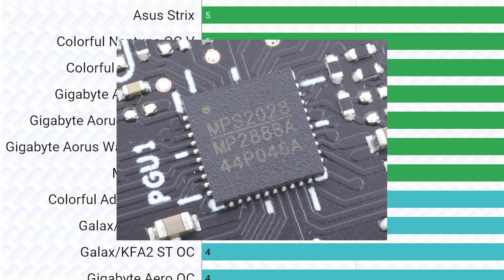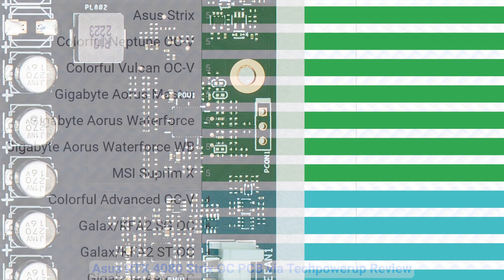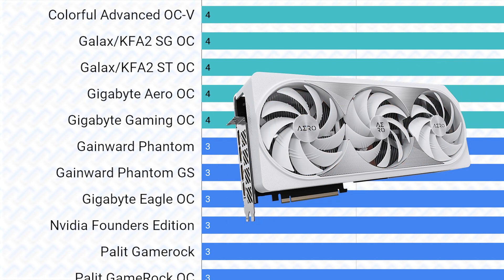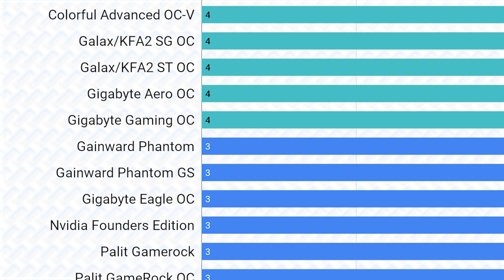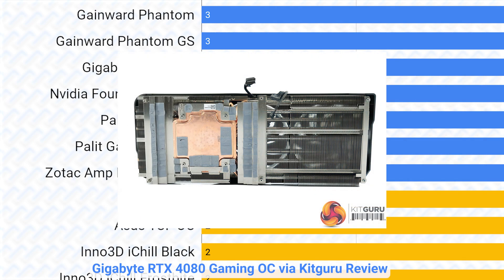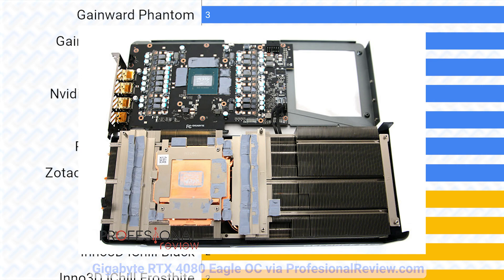Although this time the only card really suitable for extreme overclocking is the ASUS Strix, which still has a digital voltage controller with an I2C interface that you can solder to an external controller. The next tier down is the S tier, which does everything right and should be as good as it gets for anyone just looking to use the RTX 4080 or even overclock. The VRMs on all the 4080s are so overkill, and these cards all still have vapor chamber coolers with essentially the same power limits as the SS tier cards — so they're basically just as good, maybe just lacking a few extra features and better build quality of the SS tier. In fact, even the A tier cards are still really impressive. The Gigabyte Eagle OC, for example, has the same vapor chamber cooler and power limits as the Gigabyte cards in the S tier, except it has a slightly worse VRM, so it should only be an A tier card. But again, VRMs don't really matter, and this card should be the strongest contender for best value if you can find it cheaper than the rest.